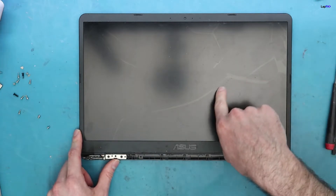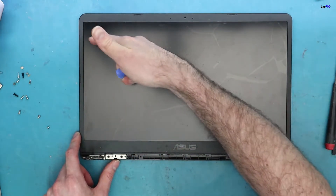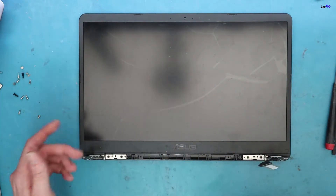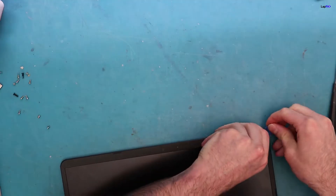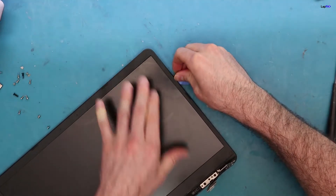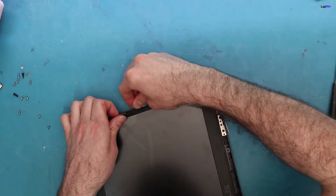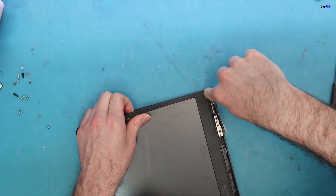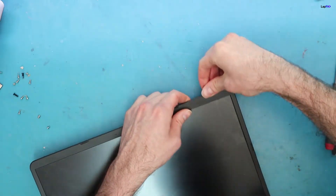You can also see the lines here — this is a very clear indicator of actual damage to the LCD itself. There's no question that this has been physically damaged, from a drop or however much the panel has been impacted. It does look to come up just with a little pry tool, the same one you maybe used before. You want to be careful with these too because it's very easy to break some of the latches, and there's a little screw tap here so be careful with that before you totally loosen it up.